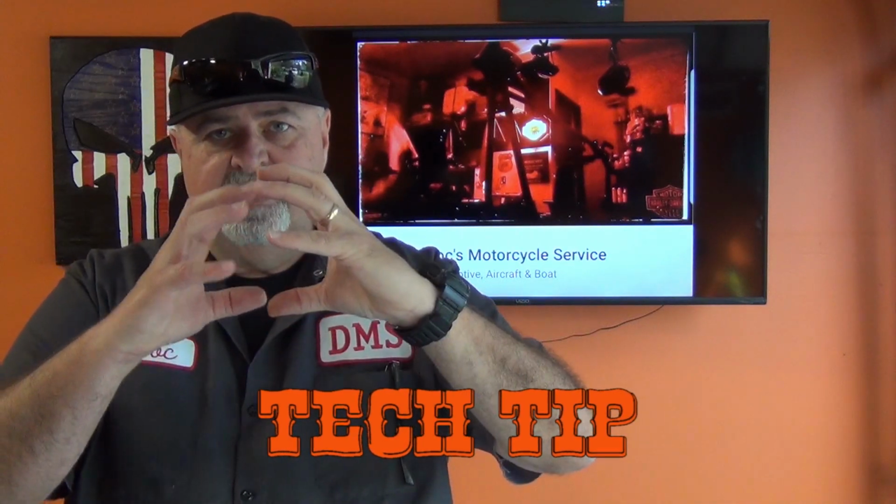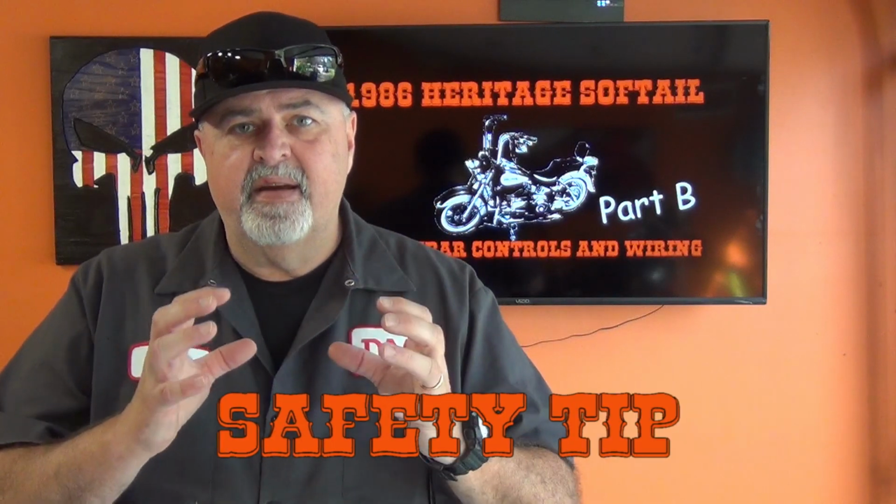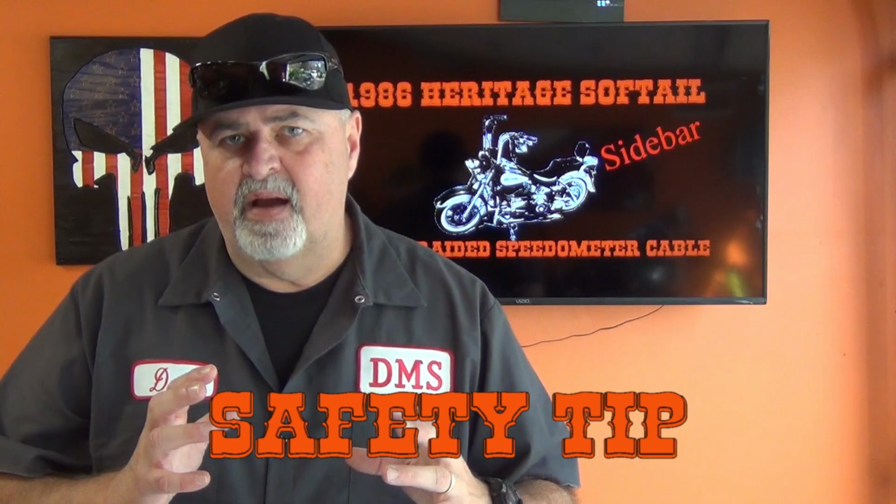Because what you have to be careful to do is to make sure that the hub, again, is not only centered in the rim this way, but this way. And if you do not get it centered in there properly, then what's going to happen is you will get a vibration going down the road. The alignment will not be right. And unless you are in tune with your motorcycle, you're not going to feel it until it's too late. I'm just telling you.